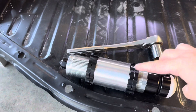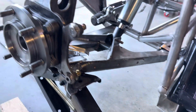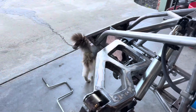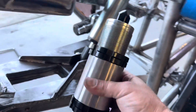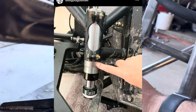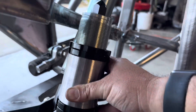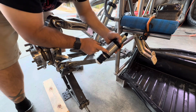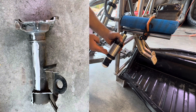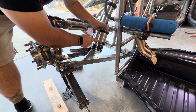I'll set this all the way at the lowest setting, so that will be bumping at four inches off the ground, but with tire squish that is likely to go to zero. This will get installed somewhere right here, just like the Dug Bug, and I'll have to figure out all the tubes that go in here to distribute the load properly. Fun fact: this tube is actually the old torsion housing — I just chopped a piece of the torsion housing and used it for the bump stop.